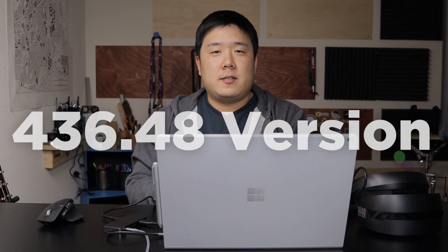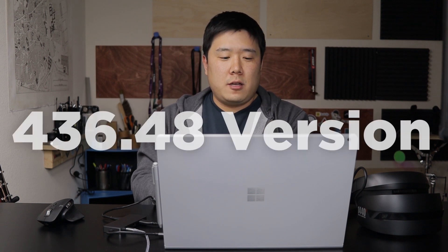There is my proof — it works very well. And if you also saw the screen recording, that means I was successfully able to screen record off of this computer as well, even whilst doing VR tasks. So if you plan on doing VR, make sure you have NVIDIA graphics driver version 436.48. I'm sure NVIDIA will soon address this issue, but it's been there for almost two months now, and there was a release on December 10th that still doesn't address this issue.